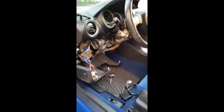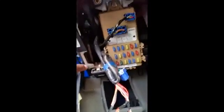I started with my 06 STI, and I saw there was a screw over here that came out really easily. There was one screw on the bottom, one screw over here, and you can look under it, there's another screw over here, and the top popped out. Pretty much it just had these little push pins right here. You literally just pull the whole dash out, and the other side the same way, just straight out, and they'll pop right out. I didn't really have any issues with those.